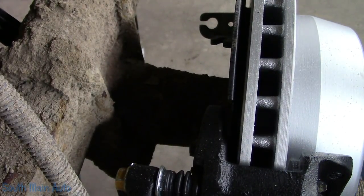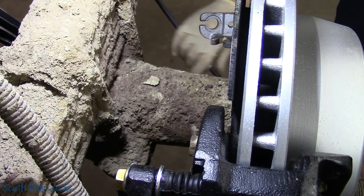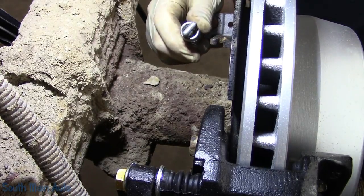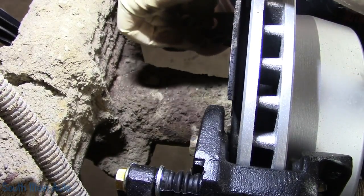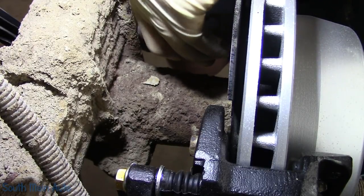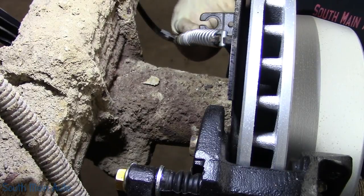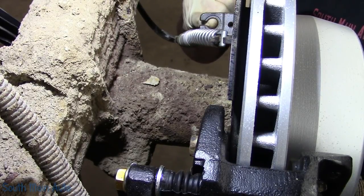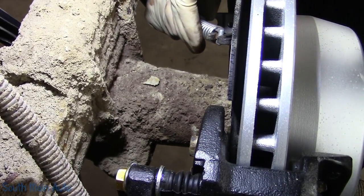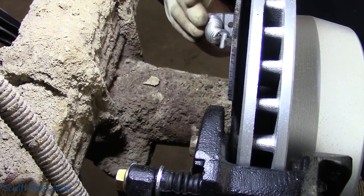This truck is so rusty — can't get my magnet light to stick, there we go. I just gotta dig down a little, get to the meat. We will hook up the driver's side cable at this point — assuming it's long enough, should be. There she goes. We're gonna hook it on that little lever there, just like so. Get the spring around and then you have to push this spring forward, get the cable through the little slot and then just let it click in. Hope that makes sense, 'cause you're not gonna be able to see. Sometimes you can hook the cable just on the edge of the bracket, pull back, line it up, click it in — just like that, and then that's all hooked up.